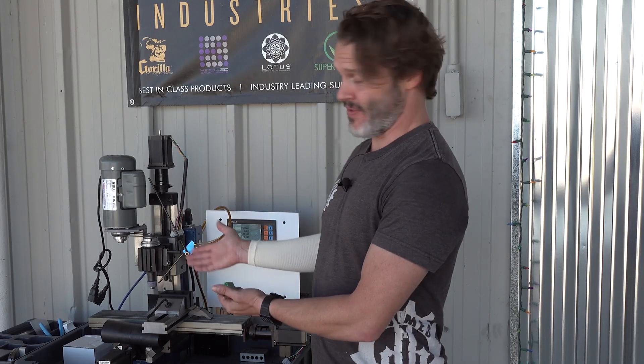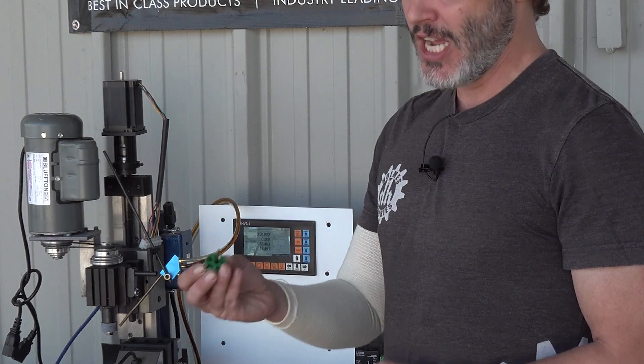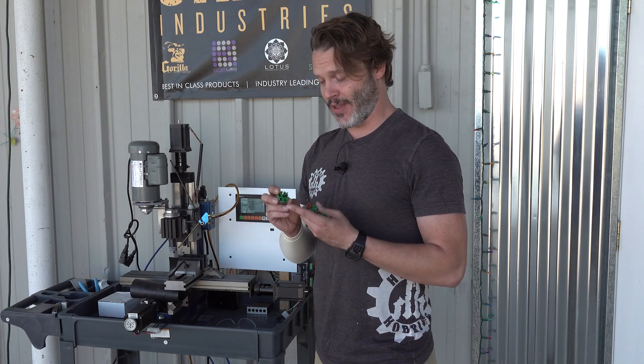This is what the grinding machine works on — they are armatures. Specifically, they are going to be either the Polar 400 armatures or the Magnum stubby armatures, because they don't actually come with a flat spot on the shaft for your pinion to set true. Why don't they? Because they want us to get 50,000 of them made at the factory, and we don't sell quite so many of these motors to do it.